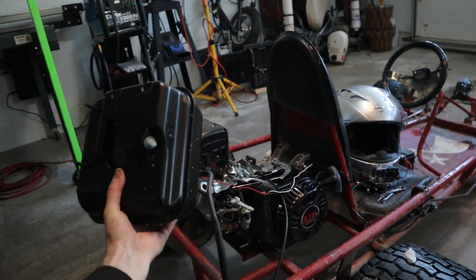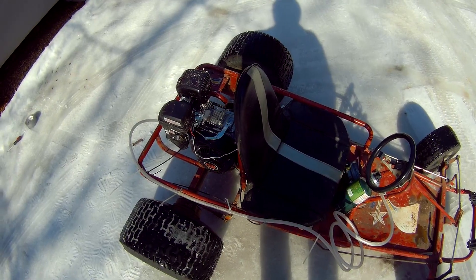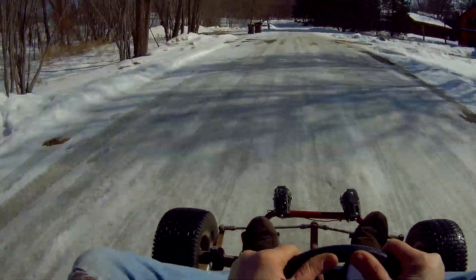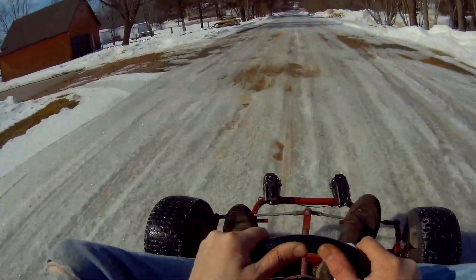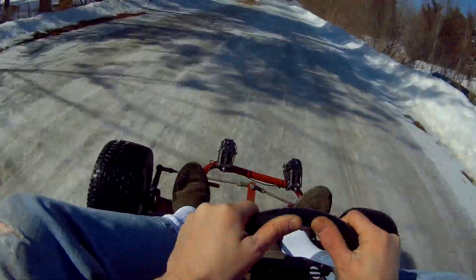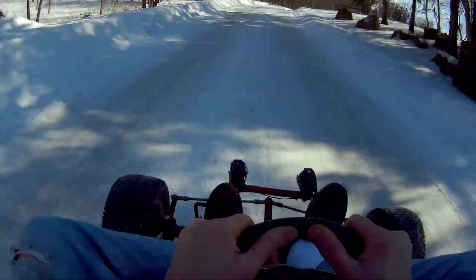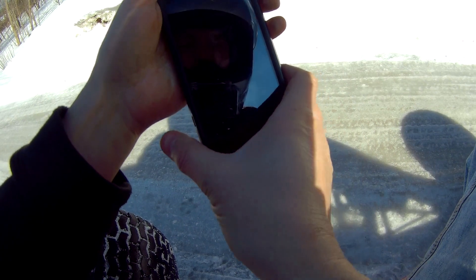With the propane carburetor on — just like that, no more gas tank. The idle needed to go back up, so a quarter turn adjustment. Now running on propane, I'm seeing 4,500 RPM, hitting 4,600 RPM. Top speed: 29 mph! Propane actually does make the go-kart faster — faster than a go-kart with so much octane boost in the fuel that it might blow up on its own!